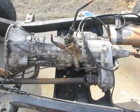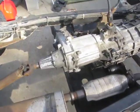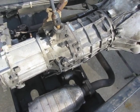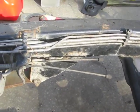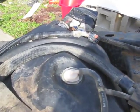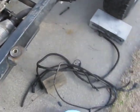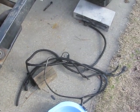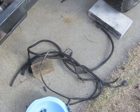And that's about it. All the wiring is now removed — that took all of two minutes. It's just so nice being able to access everything. Part of that harness I had to remove is the little wiring harness that goes back to the fuel pump, runs along the frame rail, and plugs into that harness right there. But that was simple enough. There's just not a whole lot of wiring to these YJs — a whole lot better than the wiring harnesses on those new JKs or even the later model Cherokees.